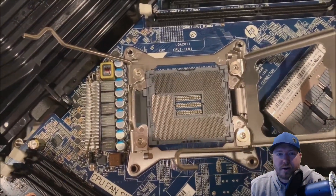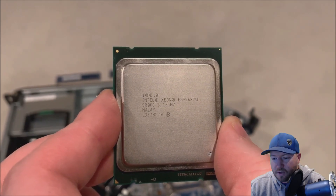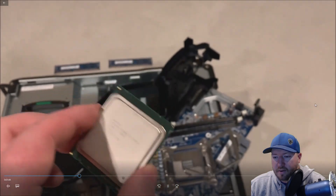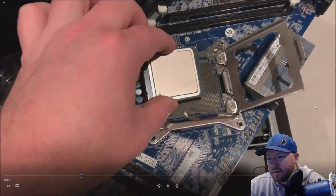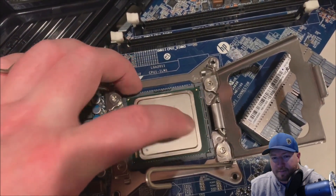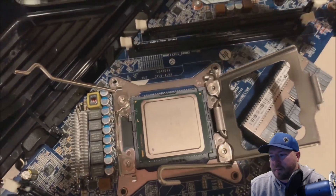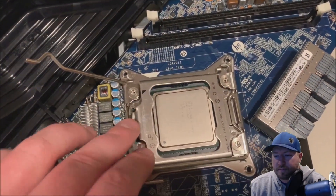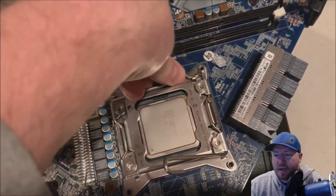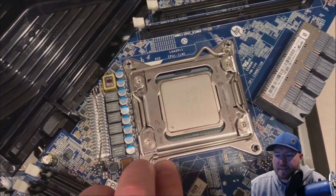All right, so we're going to line up our CPU riser board so we can install our processor. There are four notches on the CPU — you can see right here, right here, right here, and right here. We just have to line up those notches with the slot and just drop it right into place very gently. If you didn't line them up perfectly on the first shot, just pull it out and try it again. All right, so we need to put our cover and retention clips back on, and then we're ready to add some heat paste to this CPU.